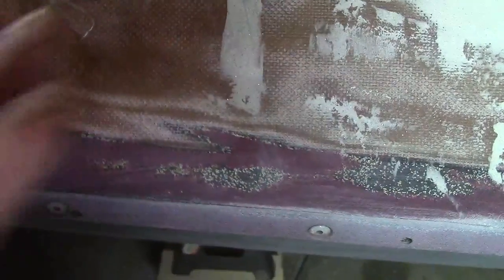It'll come out just like that and actually pretty dang nice. It really didn't need a whole lot of filling, but this is just a skim coat — this will be like my gel coat. We'll get that big old long crack fixed. It went all the way through in the gel coat, and you can't just sand and fill that because that crack will come back out the first time you take it out in the sun.